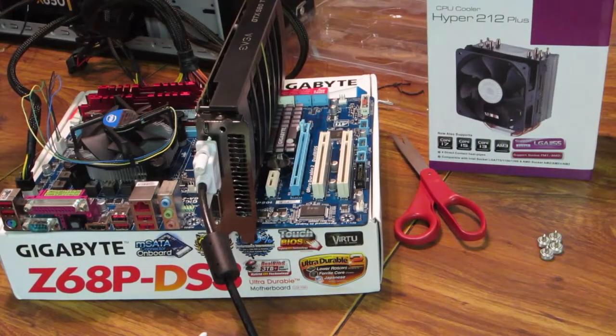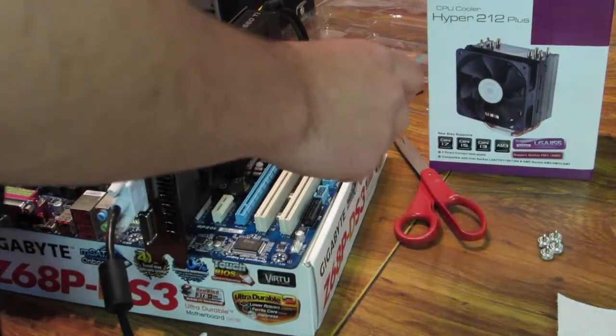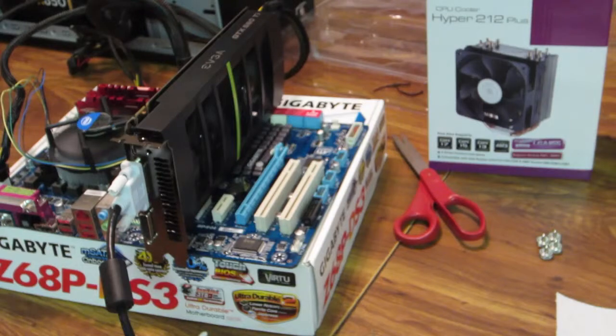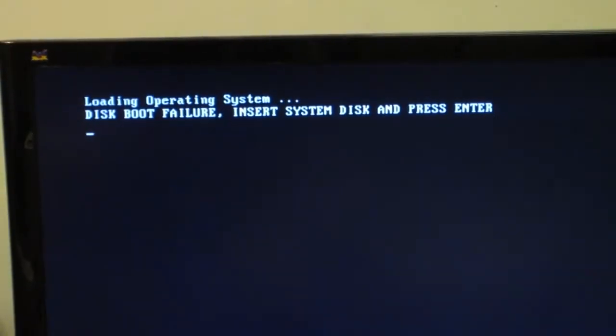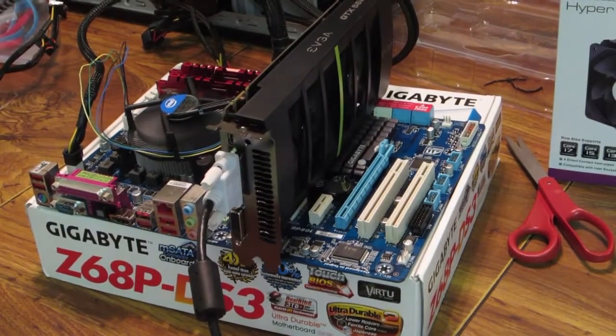So I have everything set up. I want to just test it out to make sure it all works. I have my power supply plugged in, I have my motherboard plugged in. Let me just turn on the power supply, and then where are those 2 buttons that allow us to turn on the computer? There we go. As you can see, everything's spinning. It says disk boot failure because we haven't installed the SSD yet, which already has the OS and everything on it, and my Steam library. So the beast is working. We shall put this in the case and document it. I'll see you guys in the next segment.